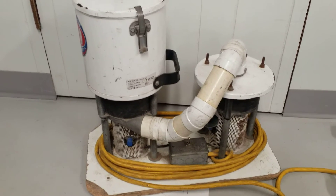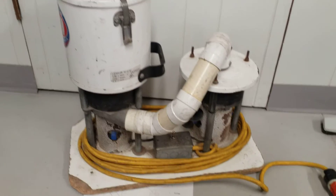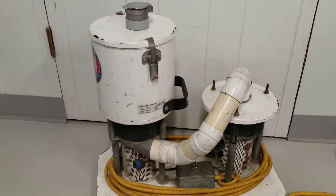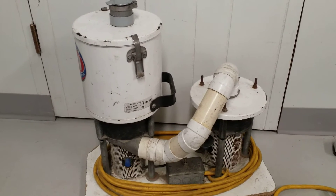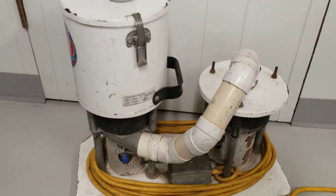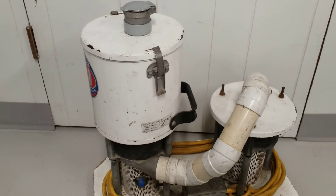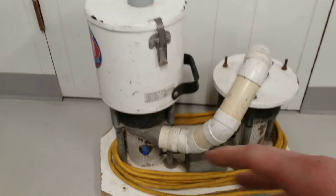That's effective, but I have actually stopped using this. Since then I've used several other service vacuums and found that really any blockage a powerful single-motor unit can't remove, this also probably can't remove. Sometimes you need a little more airflow behind that water lift to dislodge especially a partial blockage. It is quite a heavy thing — these two motors — it's not fun to carry around all day into people's houses. I also appreciate having something where the disposable bag is bigger and closed, so when using it to clean beam filters, all that debris is in a larger, usually synthetic bag.